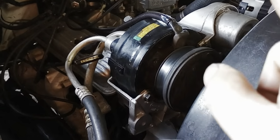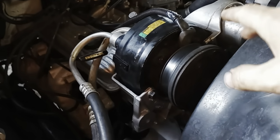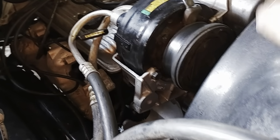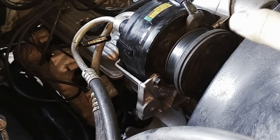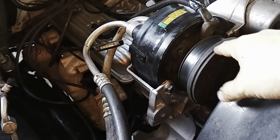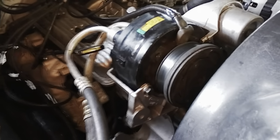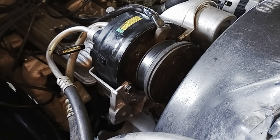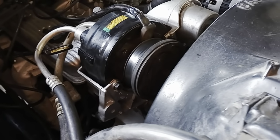First initial startup, the compressor would not turn, even without putting Freon on, trying to get the clutch to engage. I didn't even have this wire connected. I just put the belt on, and you'll see why in the video. I put the belt on because I figured I didn't have the right fittings for the AC system to begin with. So I was like, let's make sure the compressor turns, and if anything, I can drive it to work because I have to take this thing to work on Monday. So I put the new compressor in, put the belt on, started it, and had my buddy over here helping. You'll see in the video, he immediately gave me the shut-it-down signal because that thing started throwing sparks